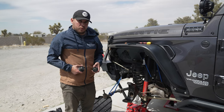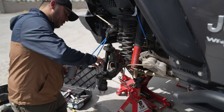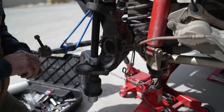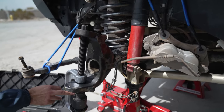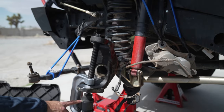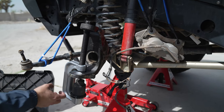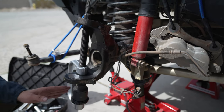You can still service them easily with just a grease gun. We're going to put some anti-seize in here to make it nice and easy and spread it evenly. We're doing the bottom one first, and it's really important that we get the orientation of the ball joint correct. I put little yellow marks on here and the two zerk fittings are facing towards the axle on the bottom. Since there's a little bit of a turning motion as it presses in, we need to make sure all these lines line up correctly up until it's fully seated.